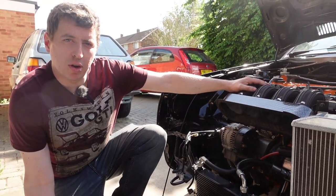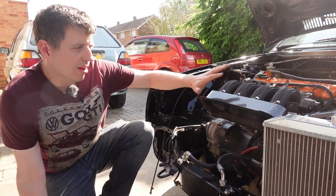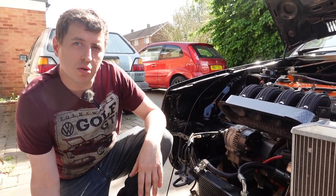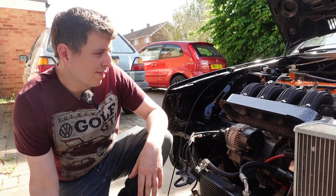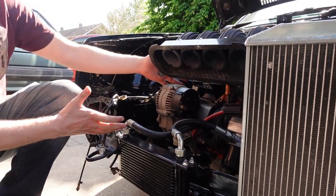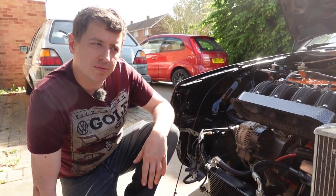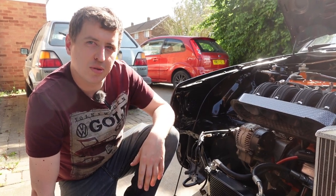With this throttle body and curved intake setup, engine all the same as it was before, this is producing over 10 pound foot of torque more and 203 horsepower. Look at all the space. Maybe room for a supercharger or an intercooler. Is 200 horsepower, 170 pound foot enough in a Mk2 Golf? Let us know your thoughts in the comments.